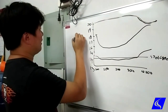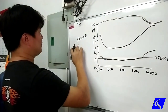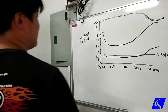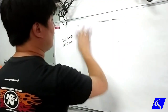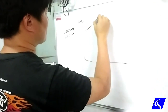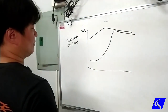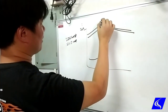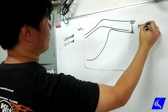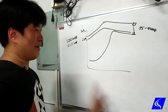We ended up with about 220 wheel horsepower, which is pretty typical of what we see with every other Terra that we've dynoed — so it's either 210 to around 220. But if you plot the horsepower graph of the other Terras, every other Terra starts low then goes high. With his Terra, we're able to increase it a little bit and it goes up more. So this range is the biggest gain — about 35 to 40 horses here. This one not too much — it's about 20 horses — because it was higher to start with.